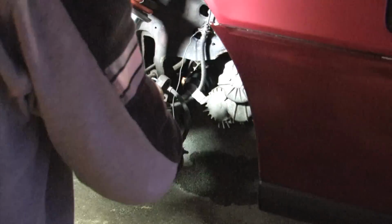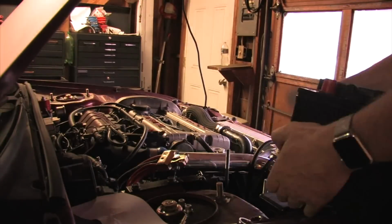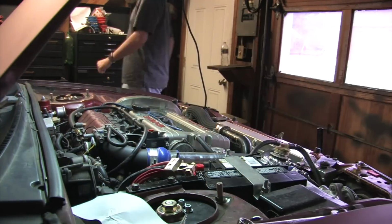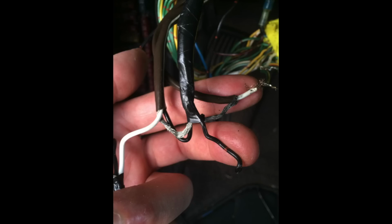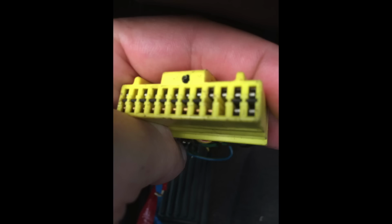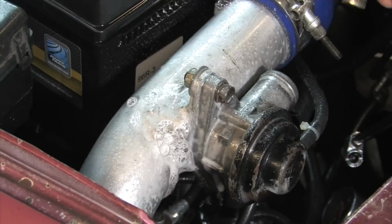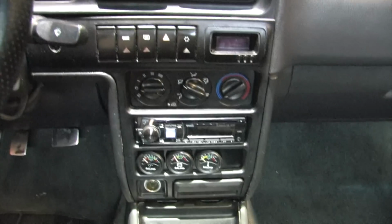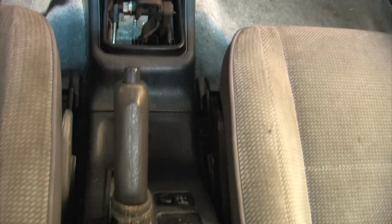I didn't change all that much really. I just installed a new front suspension, rear suspension, put the biggest radials under the front wheels that I could fit, moved the weight of the battery from the trunk back up front over the shortest axle, fixed the camber, fixed the alignment, fixed a litany of electrical issues including the knock sensor circuit, the wideband O2 sensors power source, the barometric circuit, 3 ECU pins, added a clutch switch, rebuilt the throttle body, and then fixed all the boost leaks. I even spiffed up the interior to improve the driver's environment and make everything in the dashboard easier to look at and to work on.